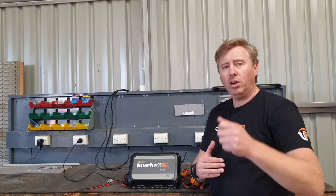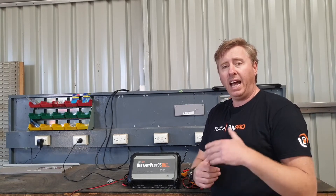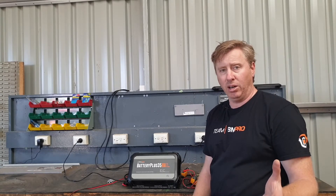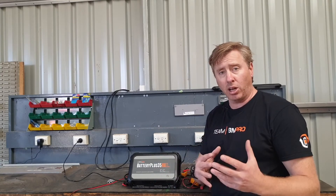It's very simple to fix though — remove the load, remove the offending load or the short circuit, whatever it may be, and the fuse will automatically reset itself. It's designed to do this. It's a protection mechanism to protect the unit and protect the load.